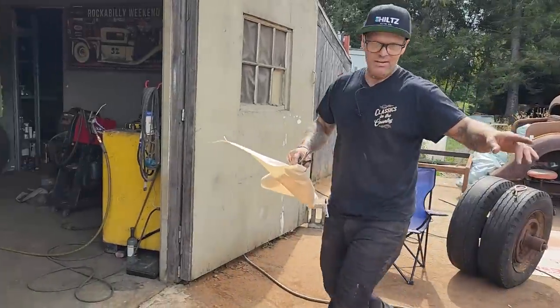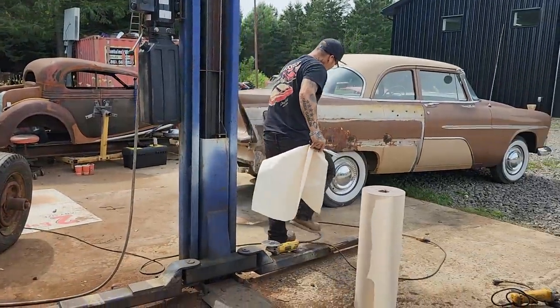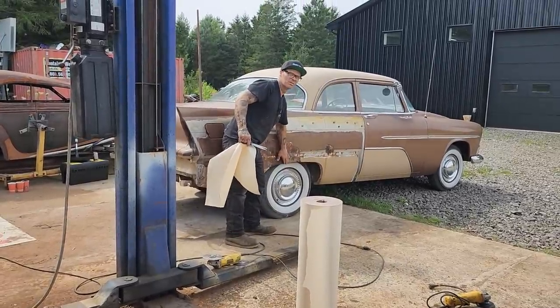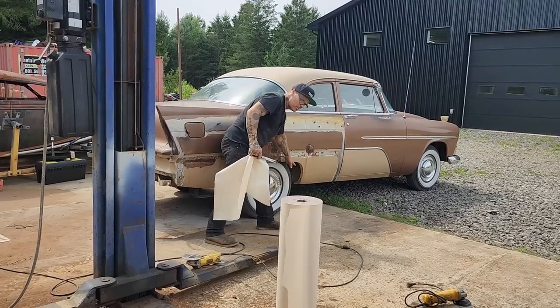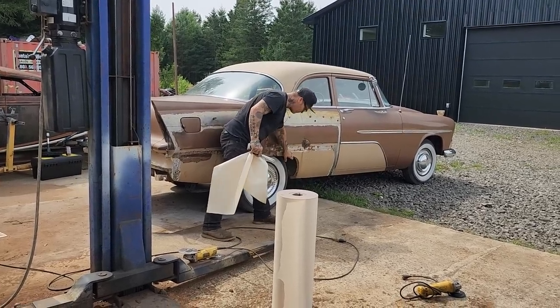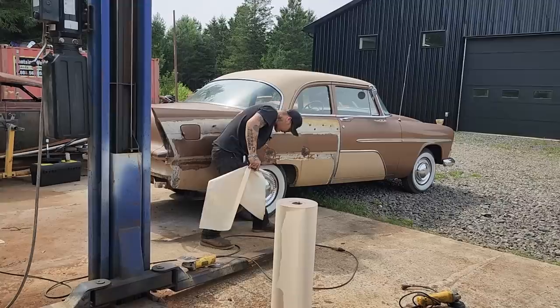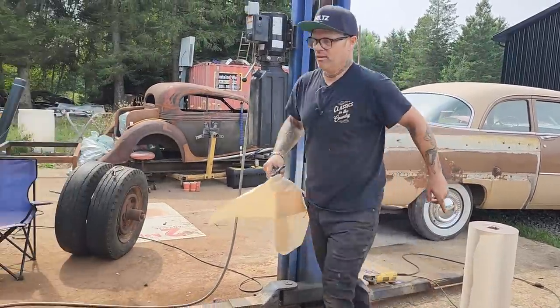But the wheel lip that I said I haven't put on that pattern, that wheel lip is going to be put on after the quarter panel. And the reason being is I can make that wheel lip, it'll actually give me the shape of the quarter panel. If I make this out of a flat piece of metal all the way around, I can make that, and then I can weld it to that quarter panel, butt weld it on, and make it look like this.